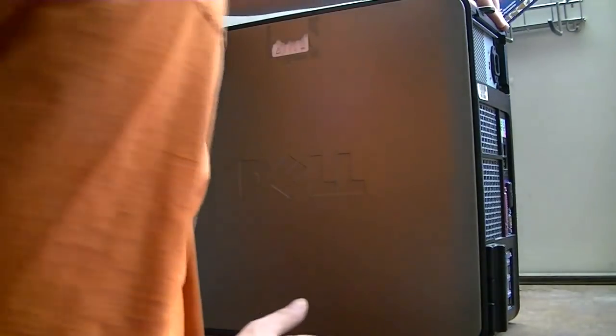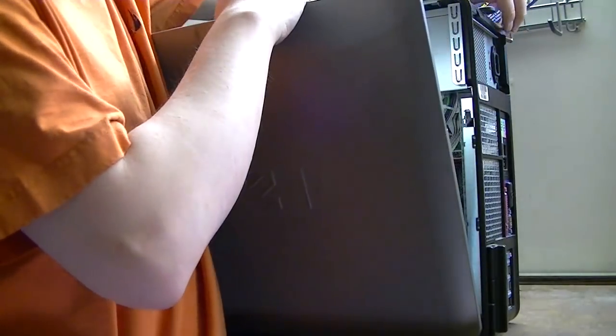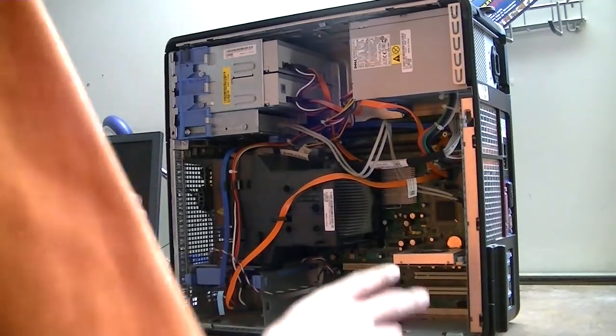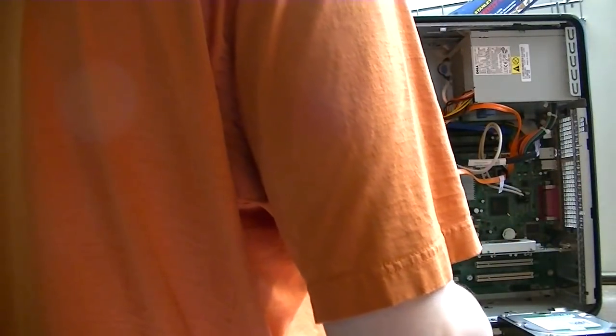I do intend, especially for my YouTube storage, to move to something a little bit more reliable at some point. But for now, this drive has served me well for 4 years now, and it's never given me any problems. So we're going to just simply hook these hard drives up to this computer, to two of the SATA ports. And we're going to boot back into Linux like we did on my main system and clone with Gparted once again.